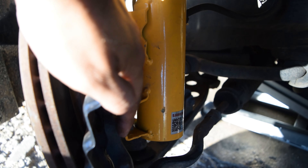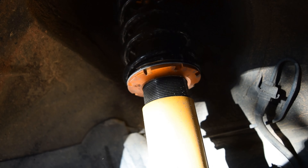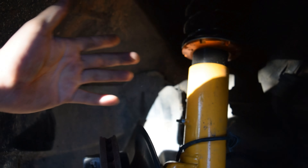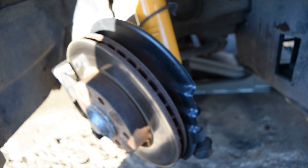Down on the bottom it's just going to be spaced out a little bit. The only thing you really have to worry about is your inner wheel clearance with your coilover — you don't want it touching. I'm going to shim this up and test some wheel fitment. We'll take this bottom bolt out and probably loosen the top bolt too, so we can swing it open, add our washers, and from there we should be good.